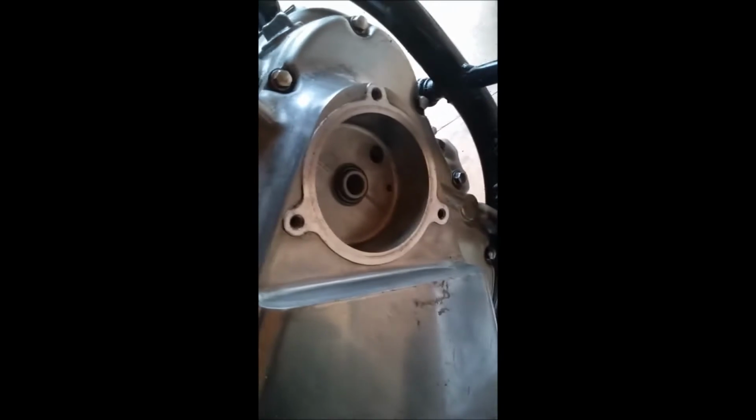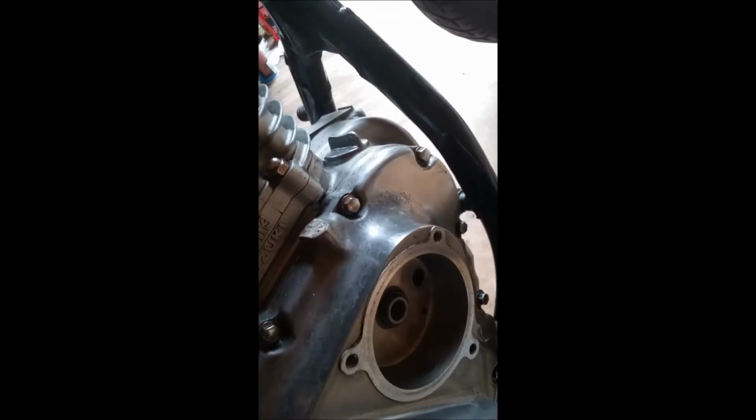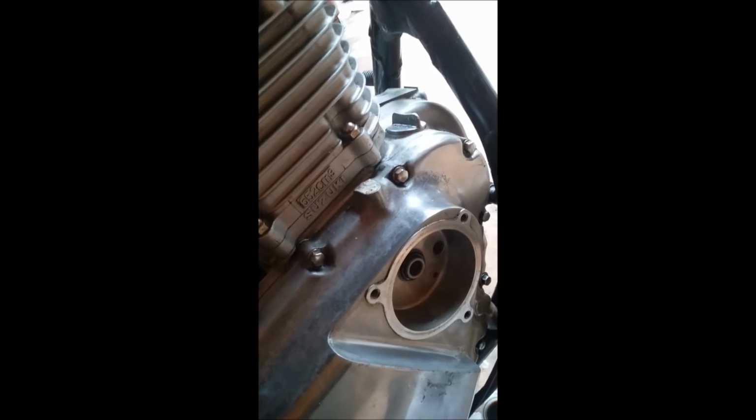And basically all you've got to do is stick the filter back in, put your side cover back on, bolt it down, put your drain plug back in, of course, take your cap off, and then put your 10W40 in. I don't have right now how much oil this needs to take, but I'll look it up and I will put it in the description.